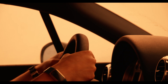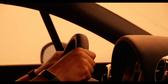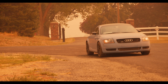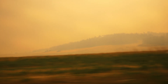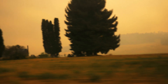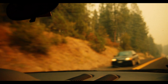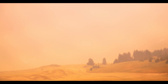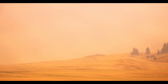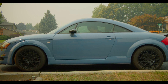There was only one real issue — at this point, the turbo was quite unhappy, and the car was unhappy. I think we honestly just waited a little too long to do this test accurately. The car's boost is inconsistent: it'll sometimes peak at 20, sometimes peak at 15, and it's hard to predict. It also absolutely doesn't hold whatever it's peaking at, so acceleration just doesn't feel good. The scanner 0-to-60 did work — it's just that the car was comically unhappy doing it. The car has a stock clutch so I couldn't really launch it, and the average time I was getting was around mid to high 6 seconds, which is pretty bad considering it's full bolt-on. In fact, I think that's worse than what the car is supposed to do stock, but it gives us a lot of room to improve.